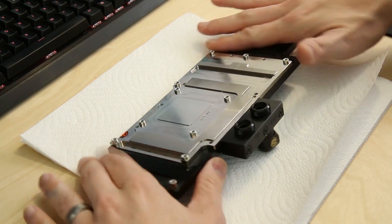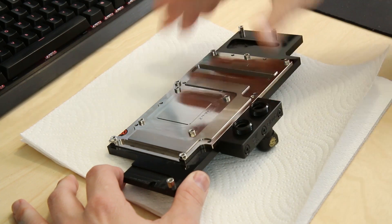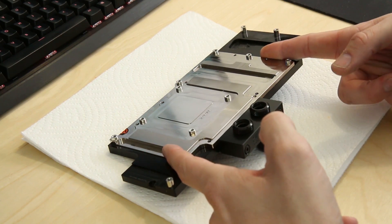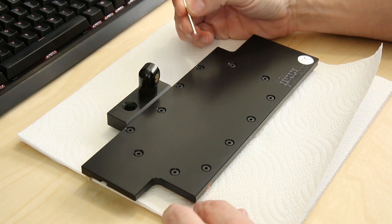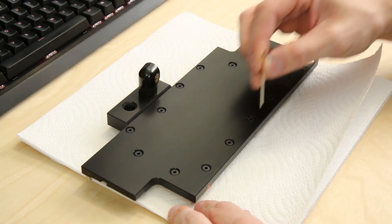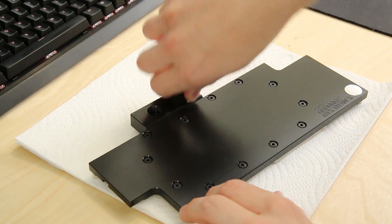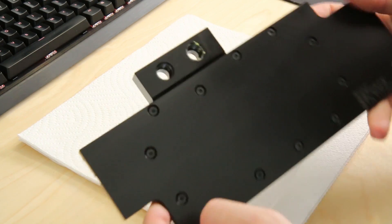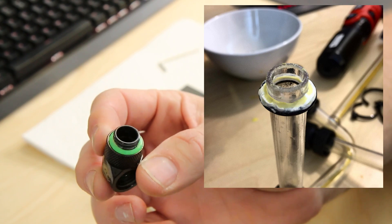Now the block I'm specifically using here, which is a little bit dusty, is the EK Water Blocks full-cover block. It is the nickel and acetal. The reason why they call it that is because the block is made of nickel - nickel-plated copper - and then we've got an acetal cover on here. It's not actually nickel all the way end-to-end; it's actually just this portion here. To take the thing apart, you are going to need an Allen key, which is actually included with the block. You're going to work your way around and undo all of these screws, and also undo the three at the end of the port. Now one of the reasons why I want to inspect this is I was getting this gunk building up on all of my fittings. You can actually see there is a little bit of a white gunk building up inside of there, and I'm curious if that's been making its way into my block. I also put up a picture of what was happening to some of the ends of my rigid tube.